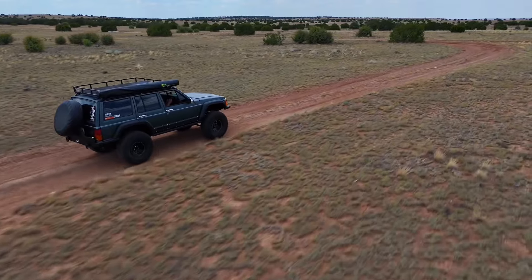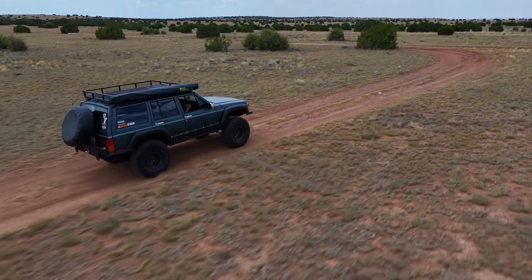And just a slew of Badlands D-ring shackles and stuff. Bilstein shock absorbers. Core 4x4 adjustable short arms — hopefully the next mod will be getting rid of the short arms and going long arm, because it rides like a tank. The lift kit is a 4.5-inch Core lift off of Ben's old Jeep, combined with a Zone lift, but with a 3.25-inch Rubicon Express spacer in the front to raise the front up.